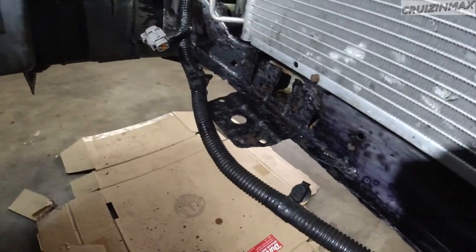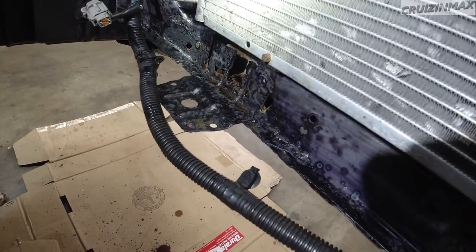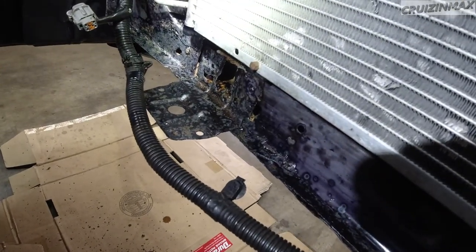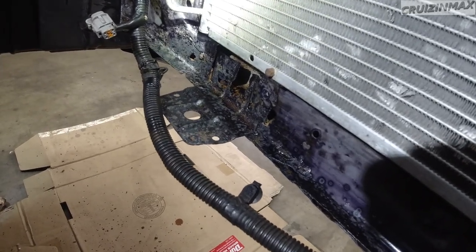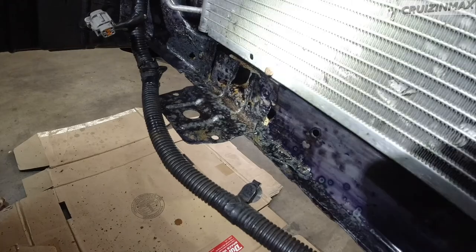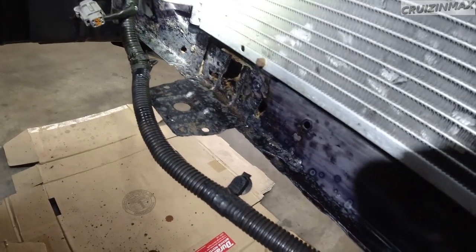Black is good. So what the brown stuff means is that it was contaminated with dirt, grease, oil. I've sprayed 2 full cans of brake cleaner, brushed it several times, but didn't wipe it because the surface is rough, and I didn't want to leave any paper or fabric on the surface. So I gotta clean that up a tiny bit and paint it again.